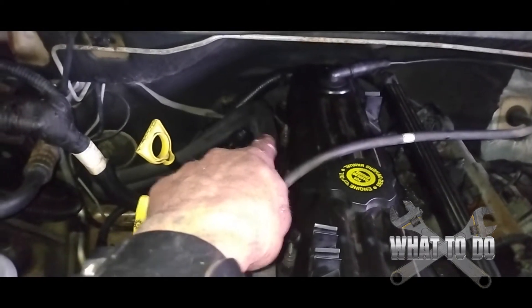With the valve cover on, when putting your bolts in, don't tighten one all the way down before moving to the next. Go around and hand-tighten them all first — just a little bit less than snug to get it seated level. Then go around and torque them all a bit more so everything mates firmly and evenly to prevent leaks. Also, do not forget to hook up that ground wire back there on the valve cover — that's very important. Hopefully this helped — please hit the subscribe button and give a thumbs up.